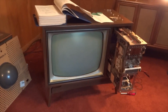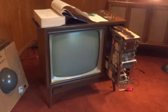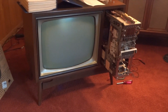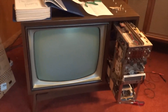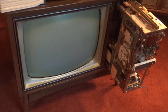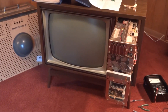This feature first started appearing in the late 60s. And as great as it was for the consumer, it was a total disaster for the longevity of the CRT, because the filaments were constantly lit regardless of whether the set was on. So basically if the set was plugged into the wall, the CRT filaments were operating.